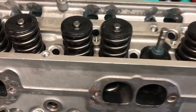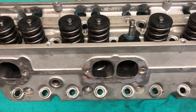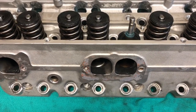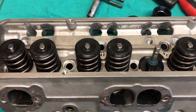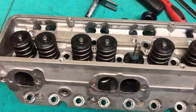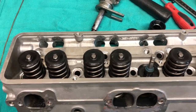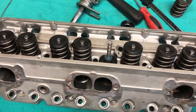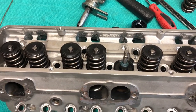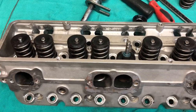I got the one back on — the new one is all done. I was about to put this other one back on and decided to talk to you guys a little bit about springs and picking the right spring. These are PAC 1226 springs. There are a couple of things you've got to look at. If you get a camshaft, your camshaft guy ought to be able to spec your springs for you. But if you end up doing it yourself or picking an off-the-shelf camshaft, you can do it yourself — but you've got to know what you're doing and how to figure it out. It's always recommended to have the person that specs your camshaft tell you what spring to use.